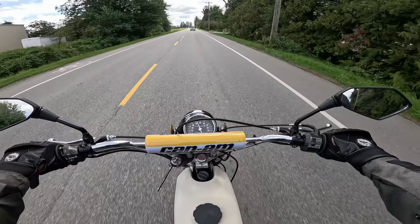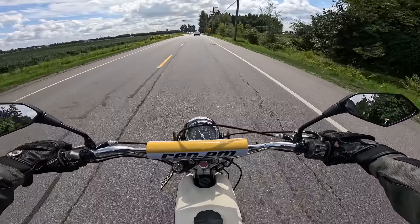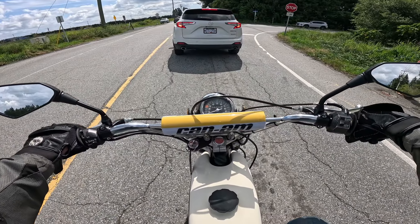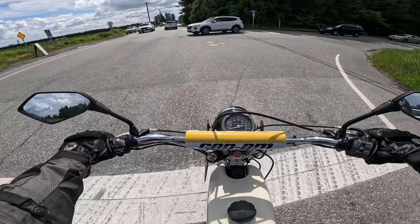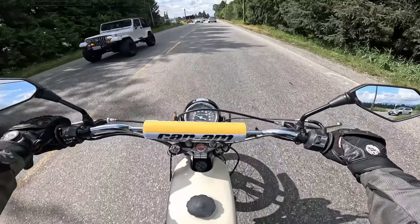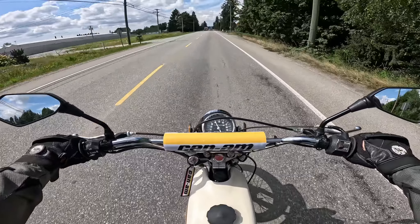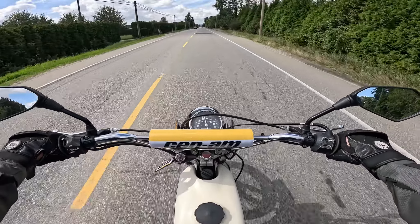I also put new Magura perches and levers on the bike. They're really good — I did that on the advice of a lot of you guys. The clutch lever really does make a big difference because my complaint was that the clutch was hard to pull. The Magura levers do work a lot better on the clutch side. On the brake side though, I've got pretty small hands and it's a long reach — the way I've got the brake light set up I'd need to have it pretty much on all the time. I'd like them closer so I can grab them a little bit easier, but we'll be okay today.